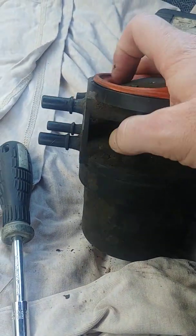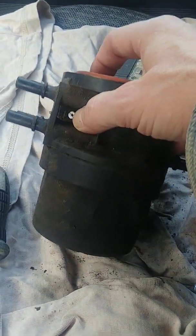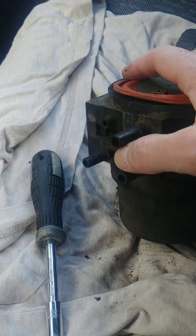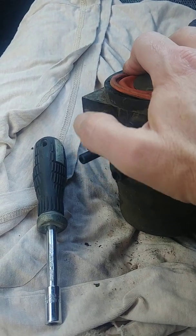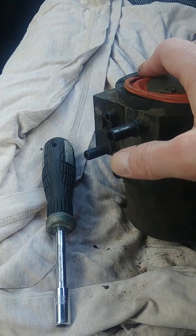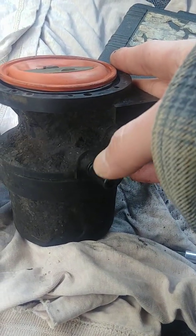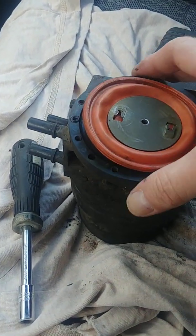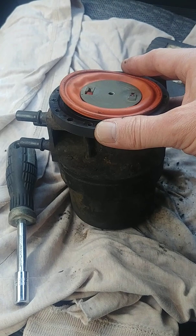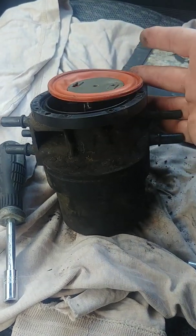On this model — and there was more than one design for one year of truck, so some 1988 Fords will have a different design — this one has no filter in the base. My truck has a fuel pump in each tank, so you have pressure and return lines from each tank. The rear is on the left and the front's on the right — you can verify that on your truck. On the other side you have pressure and return going to another fuel pump which is mounted on the frame rail. All this is mounted under your driver's seat inside the frame rail, sandwiched between a skid plate and the truck frame.